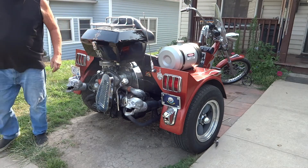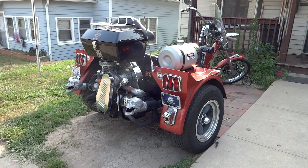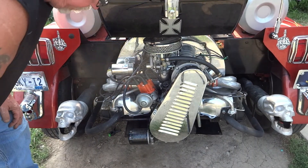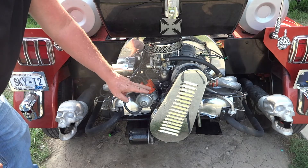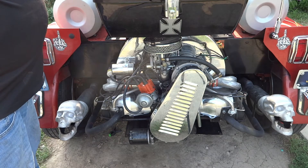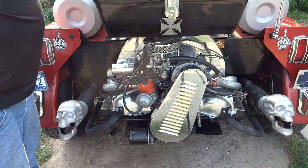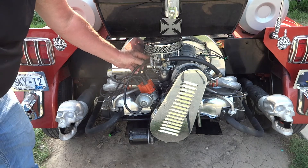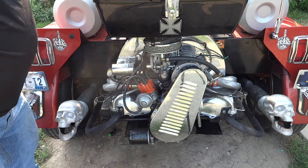I've been doing some research, and I found out on a lot of the YouTube videos I was watching that I needed a distributor called an SVDA — Single Vacuum Dual Advance — which advances both mechanically and through vacuum. Just above idle, it pulls vacuum and advances right off the line, doing away with what they call the flat spot.